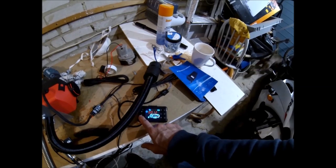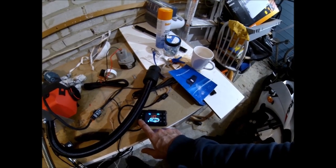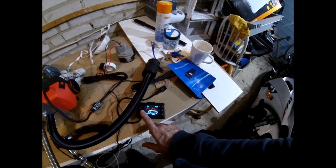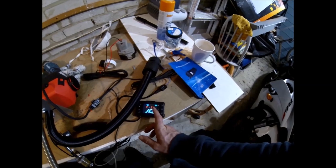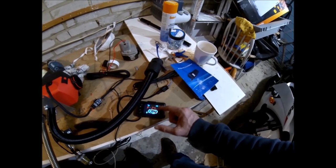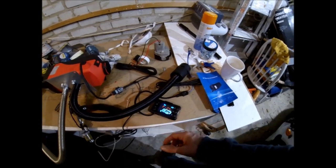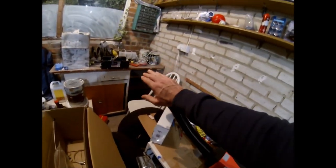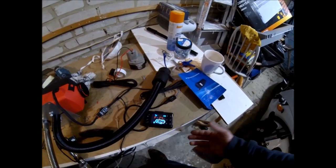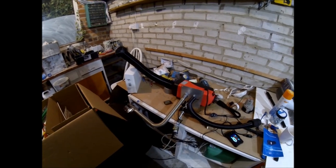So, control panel. It's 12 degrees now — I started off at 8 degrees ambient temperature and it's come up to 12 degrees. The temperature sensor is actually in here somewhere, so I've been told. The temperature you set the machine to is supposed to be in centigrade but for some reason I've got a measurement output of hertz, so I'm just going to have to scale it. The scale is from 1 Hz to 3 Hz and I'm on 2.4 Hz at the moment. All I know is at 2.4 Hz, with another 0.6 Hz left on the range, that is toasty. It's six times cheaper than a normal diesel heater if you're going to get a decent make, so I'm not complaining.